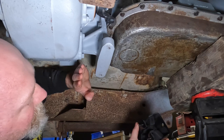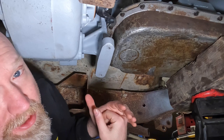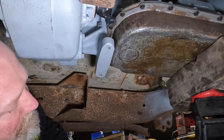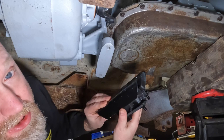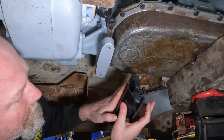Moving from that, this adapter has a 6-inch on center hole pattern down here. Now we want to try to use a transmission mount that is readily available, in case in the future someone needs to replace this and doesn't have some sort of custom thing they have to go and find. So a lot of times we'll try to find something that's readily available. This 6-inch hole pattern though is odd, and we were not able to find very easily a transmission mount that would work. What we ended up finding was that a Cherokee transmission mount is really close. This whole pattern is so close that we're only going to have to take about an 1/8 inch off of the inside of these holes to get this to fit up in here.